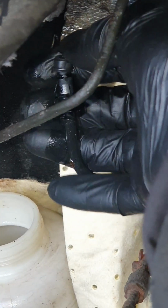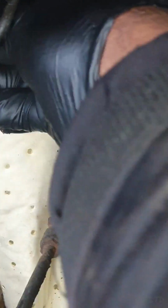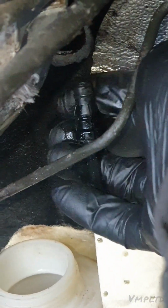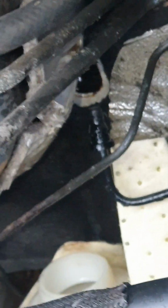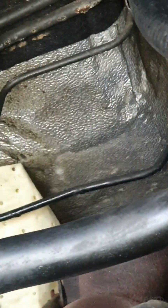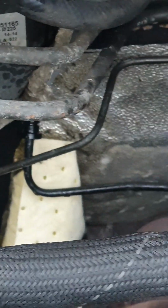So ensure that that's sitting flush on top of the brake hose like that before you put it back into the master. Otherwise, once you're trying to get it running again, brake fluid will just be seeping out of there and you'll be trying to figure out why. So yeah, make sure you keep those little bits safe, and then the rest is just mechanical. You can just start attacking it. Well, last of all is this clip, but you should be able to work out how to get that back off and replace it with a Jubilee if you need to.